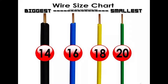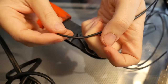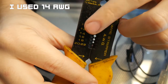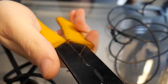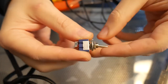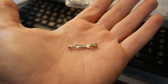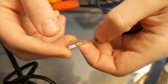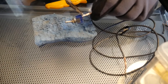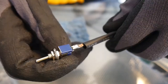Typically the wire for the interior of the car is 16 to 18 gauge. I'm using 14, so I want to get anything less than 16. Now that we've got the wire size established, we need to trim the edges to make a solid connection. Make sure you use the correct wire stripper size — anything smaller than the wire size can cut away the copper inside and cause problems later. After you strip the ends, now the fun part: I have a really small switch, so I had a tough time soldering directly to it. I ended up buying 2.8 millimeter connectors so it can easily snap into place. I added a little solder to the connection between the wire and the node of the switch, then used heat shrink to make sure they didn't touch.